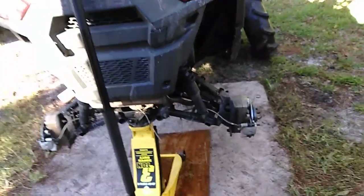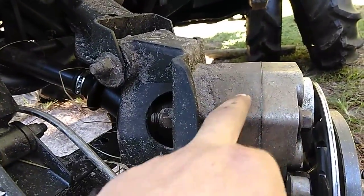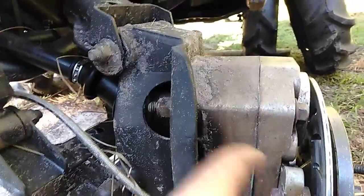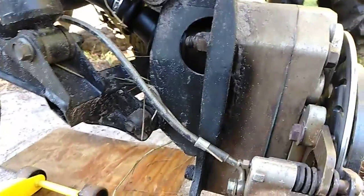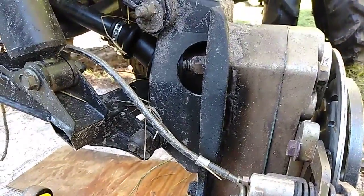And this gear oil issue, I am getting so tired of changing these gaskets. I mean, you can just see it seeping out all the way around the box. I tried everything. I tried putting a bunch of grease in the bolt holes when I put it together, just to kind of help seal that if some oil does get in there. It doesn't work because there's constant change in vacuum and stuff because these things aren't vented. The water will work its way in there if there's any leak anywhere.